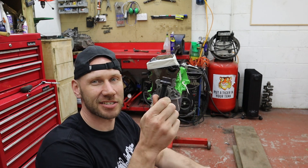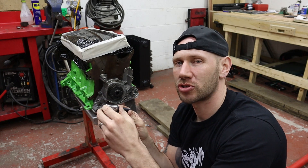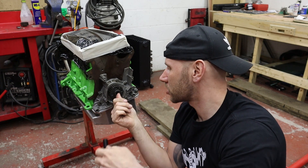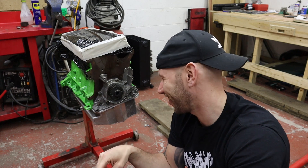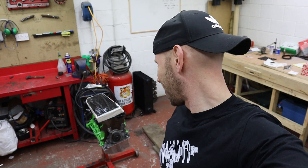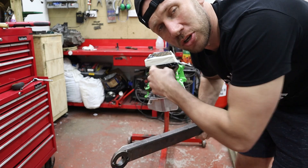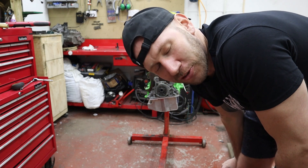Time to fit the crank pulley bolt. This is an Integrated Engineering ARP bolt, and this bolt takes a 13/16 12-point socket — one of those funny American sizes, but it is an American company. It goes in here with red Loctite, 78 foot-pounds plus a quarter turn. I imagine that quarter turn will be pretty difficult, so there's a good chance you might see me struggle here a little bit. But the really cool thing is I get to use the Mark II crank pulley tool — surely you've seen the video where I make this tool. If it works out you'll probably want to copy it, and if it doesn't I'll probably edit it to make it look like it does.